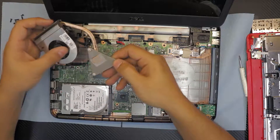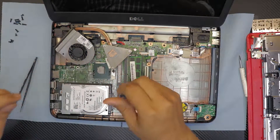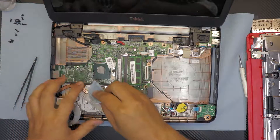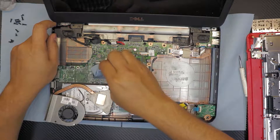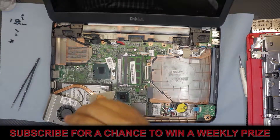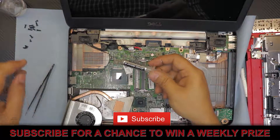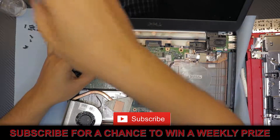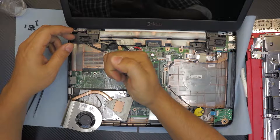Removing the heatsink — the fan is really clean because it's never been used. We're gonna remove the old thermal paste using 100% alcohol; I'll leave in the description where you can buy it. It's really easy to remove the thermal paste. Do not use regular alcohol — it's bad because it has 70% water. Once we clean it up, grab a thermal paste — you can use Arctic Silver 5 or any other brand; in this case I'm going to use MX4. Put a little bit right over the CPU, just a tiny line.